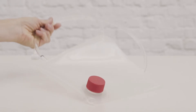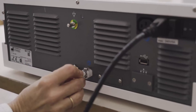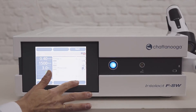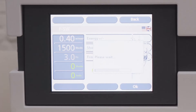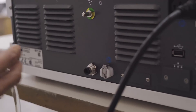The first step consists of filling the water bag with demineralized water. Connect the water bag to the white connector on the back of the device. Hold the water bag above the unit to fill via gravity. Then press OK. Do not squeeze the bag to speed up the process. Check the display showing the status of the filling process. This may take several minutes. When the water filling is completed, the display will prompt you to remove the water bag and touch OK.